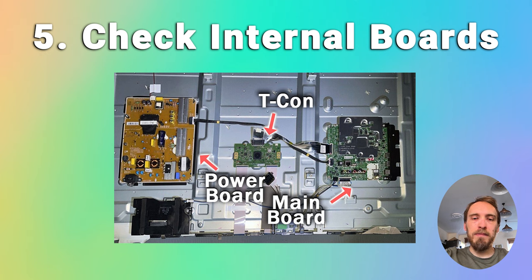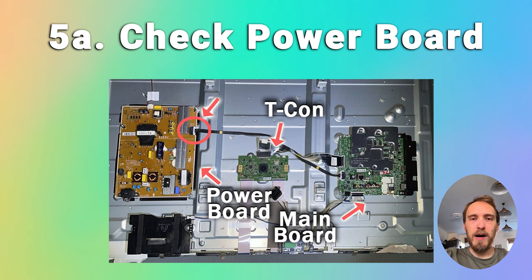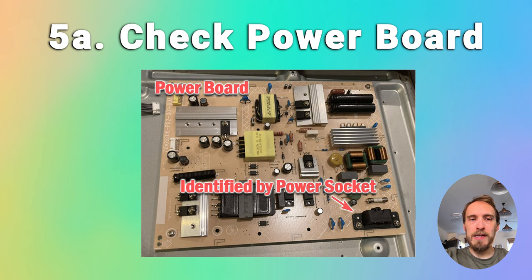If you've tried that and the picture is still off, look at the power board and try to localize whether the problem is with the power board, the T-Con, or the main board. Unplug your TV, then with all other cables plugged in, unplug the single cable linking the power board and the main board. This cable allows the main board to control the backlights, and disconnecting it means the backlights should default to an always-on state. If you switch your TV on with this cable disconnected and the screen is working, you know the power board is okay. If you still have no picture, there's most likely a failure of a component on the power board. You can check individual components with a multimeter or replace the power board for about $30 on eBay.